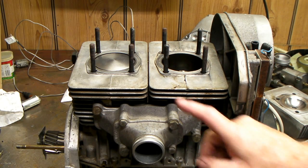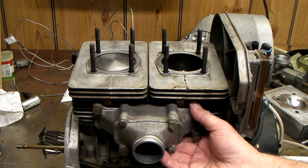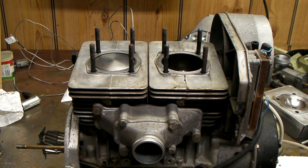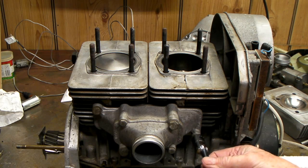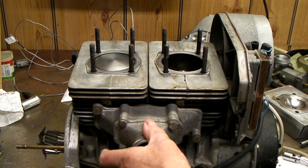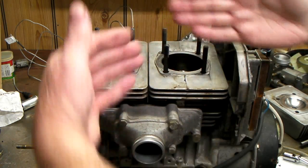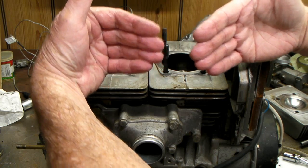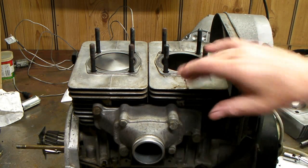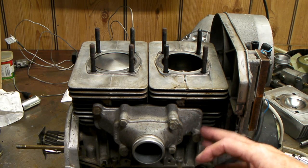This particular engine has a single intake manifold, so I put that on loosely — no gaskets, not tight — but it's a flat surface that's going to hold these cylinders parallel with each other so one cylinder isn't twisted on there. I do that just before I tighten everything down.